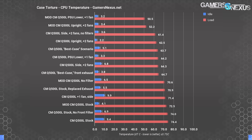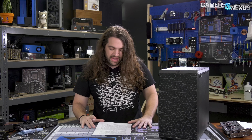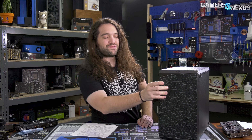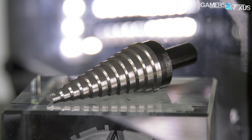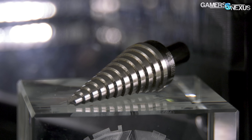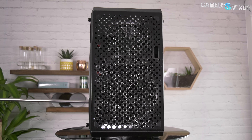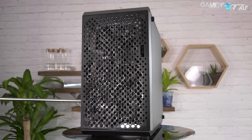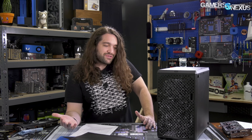The bottom fan moves some of the GPU's hot air up and into the CPU chamber, and you're also dealing with radiative heat off the backside. As in the original review then, it's best to just go with a different case. We improved it, but not really in a usable sense — it's very ugly, though you can cover it up with the filter. If you actually wanted to do a mod, you could obviously do a much better job: sand it down first, use a step bit that's not quite as aggressive, use a fixed size every time, and find a way to keep the front panel flat and not warping. It's an odd case — a micro-ATX case that's been adapted for ATX — and clearly some corners are cut for thermals.